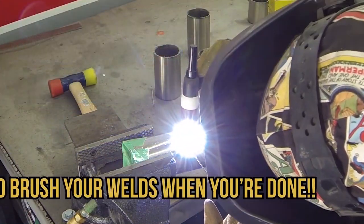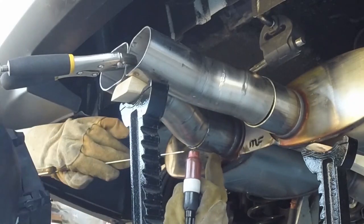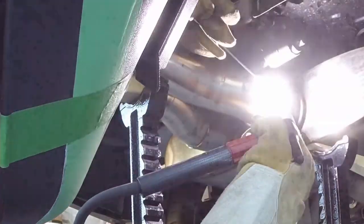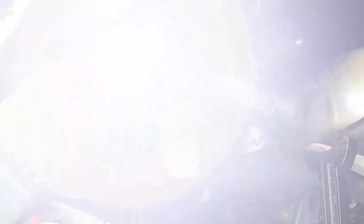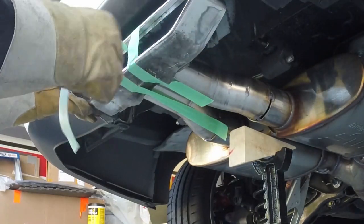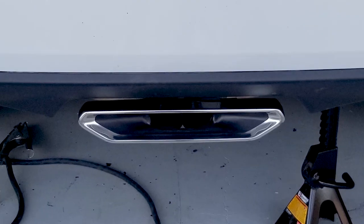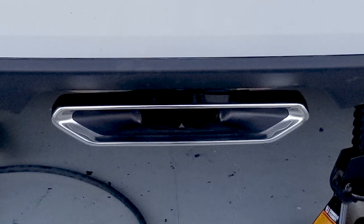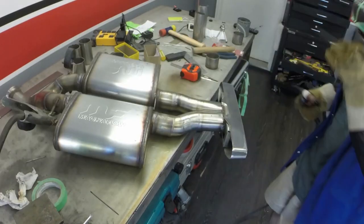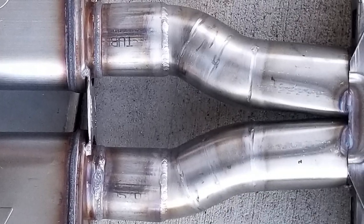Once the tubes are nice and solid, it's back under the car to position them on the muffler ends. I'm using wedges to get fine height adjustments — I know, it's a little old school, but they do the job pretty well. The OEM tip goes on next, and after a bit of repositioning, the fit is as good as the factory intended. The now nearly complete rear section comes off one last time to weld everything solid, and when the whole thing is nice and strong, the double hanger is welded on to keep everything nice and secure.